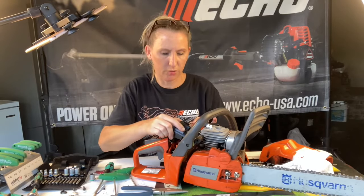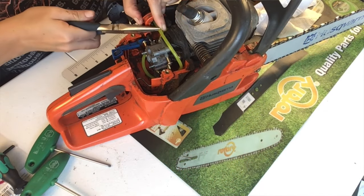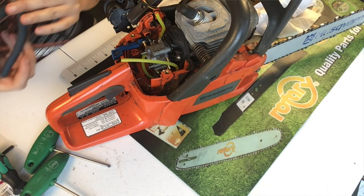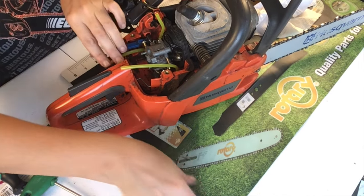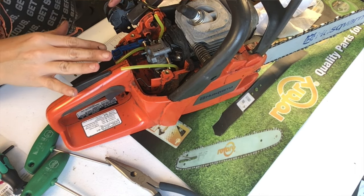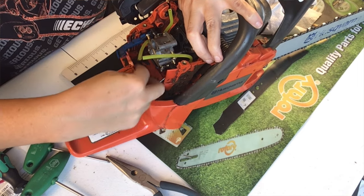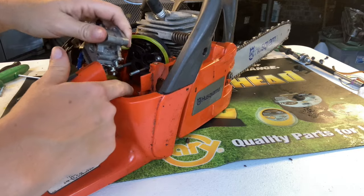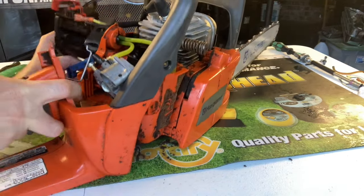We're going to remove the air filter base now that we have it unattached, and take the carburetor off. I'm going to go ahead and take off the new fuel lines that I just put on at the primer bulb to get it out of the way. There's also another fuel line at the bottom. A lot of times when you get into these, all the fuel lines are deteriorated and you have no idea which way they go back on — I'm going to show you exactly how they go when we put it all back together. Now that I have all three lines unattached, we're going to pull the engine up away from the handle a little bit and pull straight out. The throttle trigger linkage is still attached but that's okay. Once you've released all the screws from your handle and pulled the carburetor off, you can pry it back a little, pull the carburetor off, and then release the throttle lever linkage and take the whole handle off and move everything out of the way.